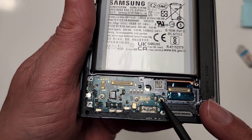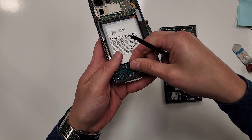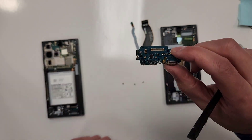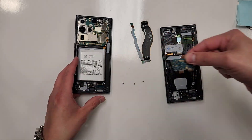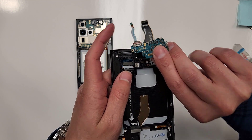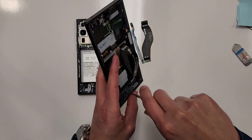There are one, two, three screws here — let's take those out. I'll grab my little plastic tool and get under this, and then this thing will come out. This is the charging board cable — also the SIM card goes right in here. So if your charging port ever goes bad, this thing is replaceable; generally these cost around ten dollars. We're just going to transfer it from the old screen over to the new screen. Place the charging port in first, make sure it goes in there, then take the three screws and screw the piece back down.